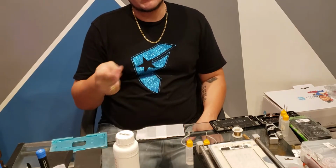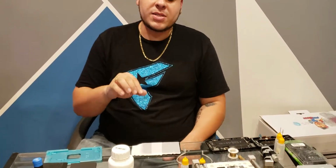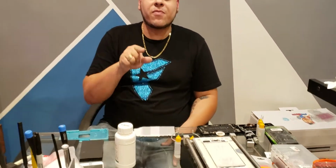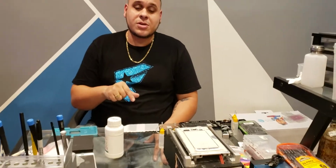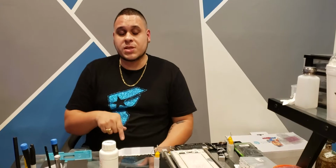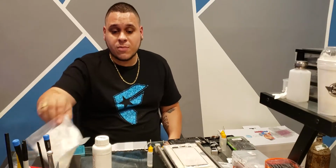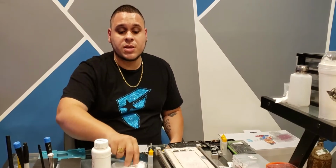But there's a white residue that films on the screen. And if you get that white residue, there's something else nobody says. The only way to really get it off is more 8222. So the best thing is, while it's still wet and you pull this off, hurry up and hit it with some clean room wipe with some acetone before it leaves that residue.